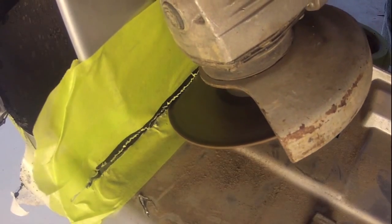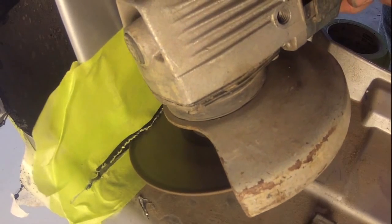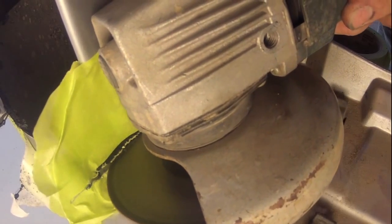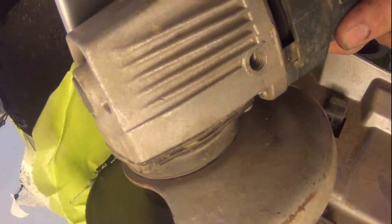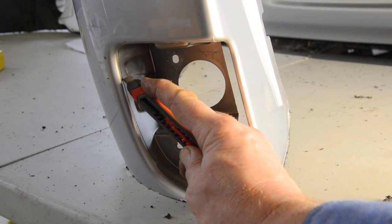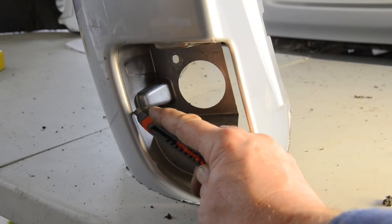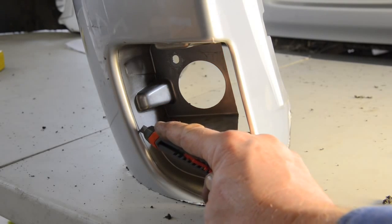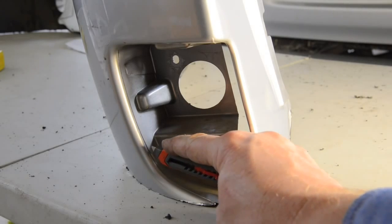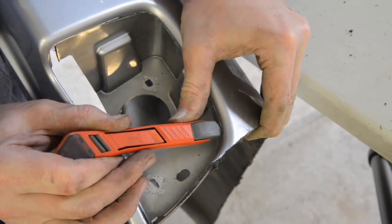Next, move to the step area of the bumper and cut along the curve where the vertical inside edge meets the step until you meet the first cut at the reflector recess. With both wing tops now cut off the bumper, you need to carefully remove the shrouds within the wings where the reflectors were removed, without damaging the outer curve. I, with extreme caution, used a sharp knife for this step, but it could also be done with a Dremel